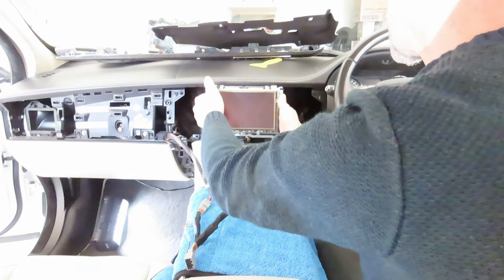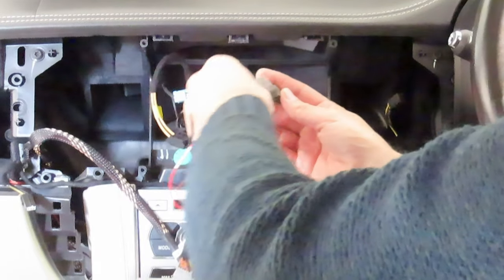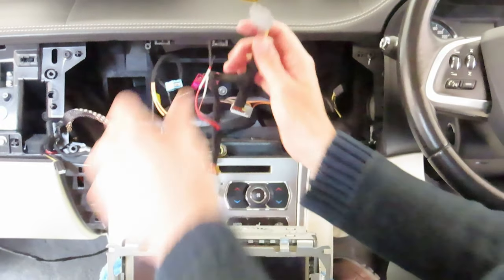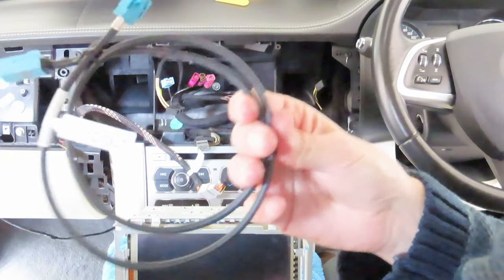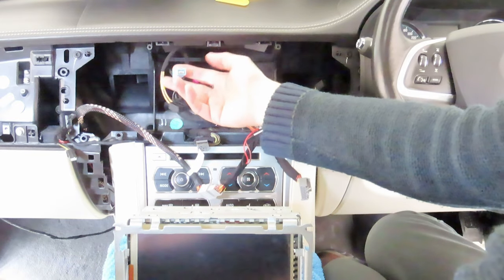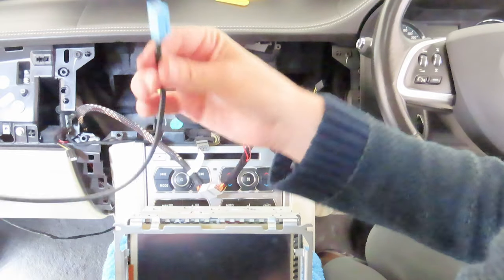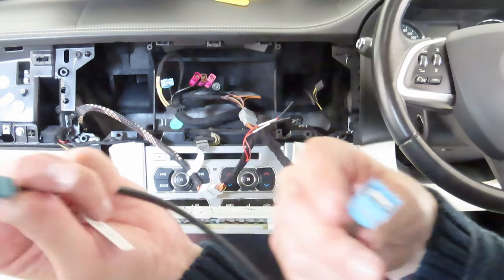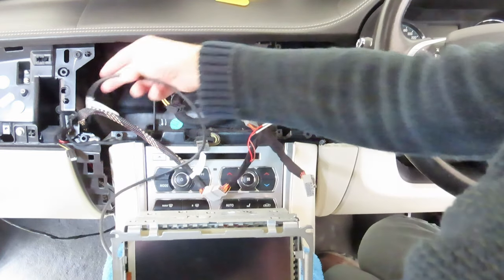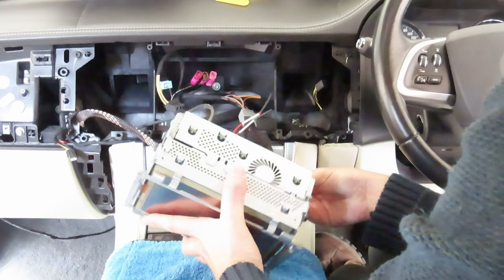This grey plug that you took out of the back of the head unit is just going to plug into the female socket of the ones they supplied you, and this end plugs into the back of your head unit. The LCD cable plugs into the back of your head unit — you'll see that you unplugged a blue LCD plug from the back. You're not going to do anything with that one anymore; just leave it and use their cable instead. This plug will go into the back of your head unit and this side of the cable goes into the back of the iD Core unit. We're also going to run that cable down into the footwell, and I'm just going to plug the power in here as well.